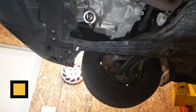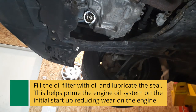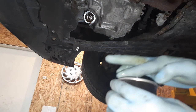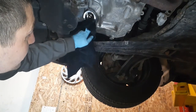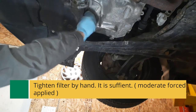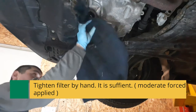You've got a brand new washer and a brand new oil filter. We're gonna fill that filter with oil to prime it — you just fill the center of the oil filter with oil. Then take some of that oil and lubricate the seal. I want to make sure that the mating surface is clean. These filters are good hand-tight; you don't want to over-tighten them.